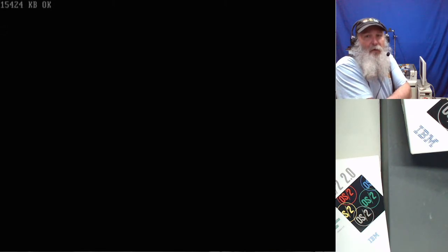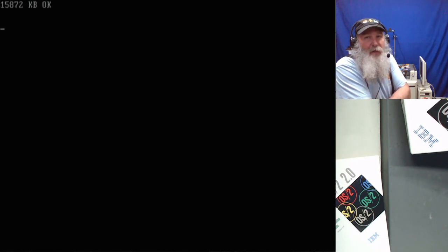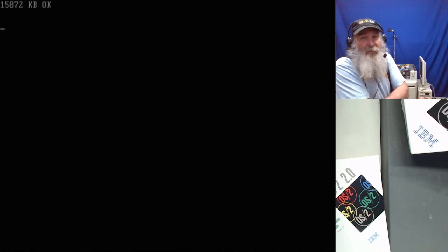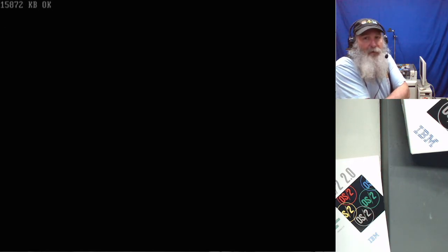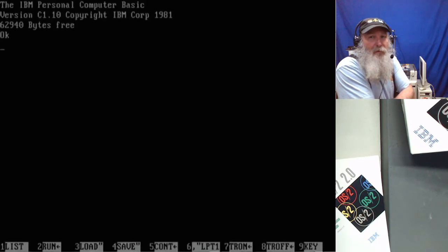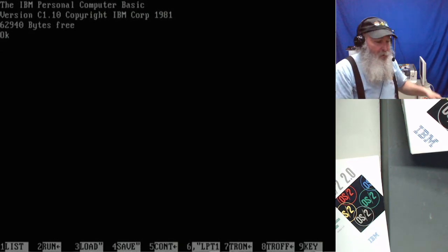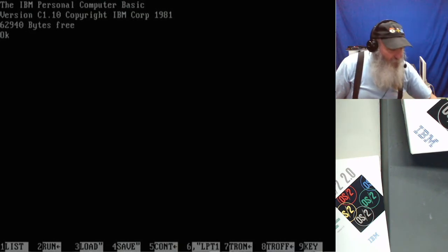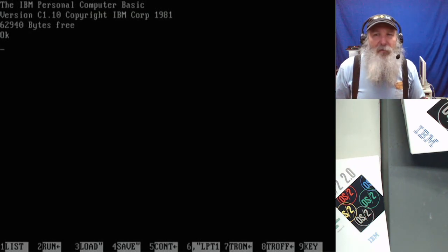I could also, if this doesn't boot, connect this up to another system to look at those files, but I don't know how interested I am in that. I could even go through the installation process with this first before swapping the SCSI drive, to have OS2 partition and repartition the drive, and that may get OS2 functional on it. So we learned that there's something to this installation that's just not working.